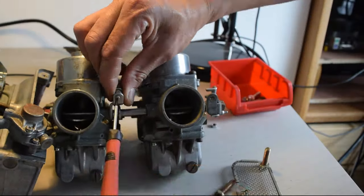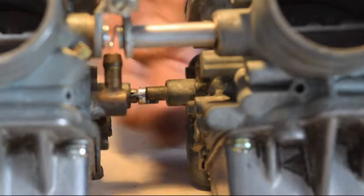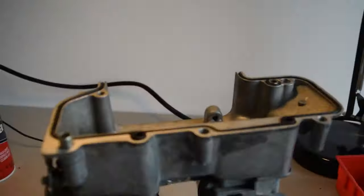I'm using a silicone new connector for the chokes. We can now put the carbs together — first the throttles are connected, ensuring to include the link spring, and then the two chokes are connected using the choke connector.